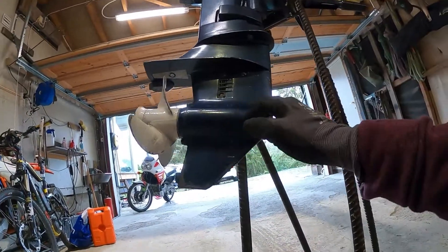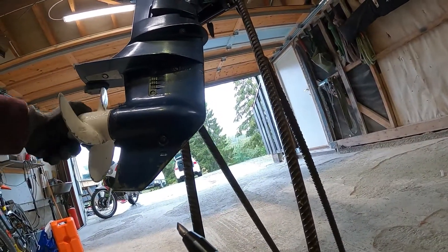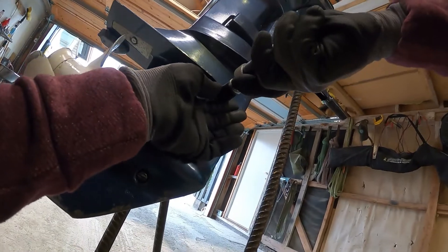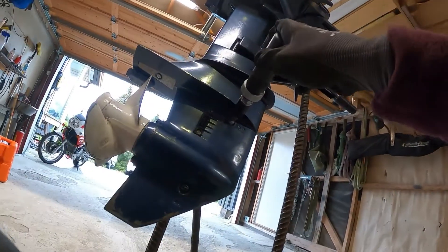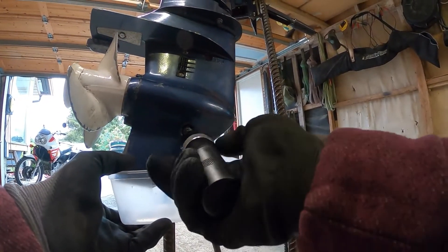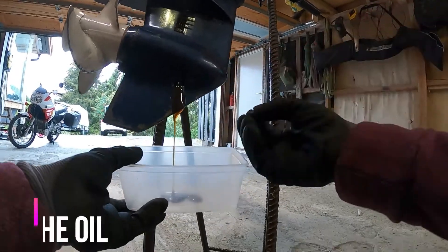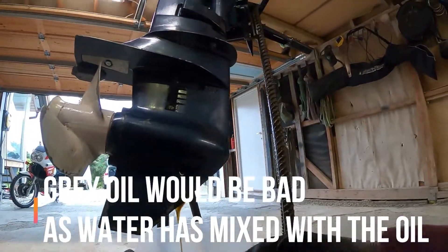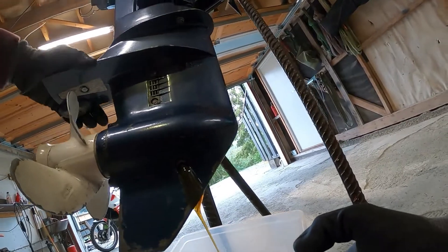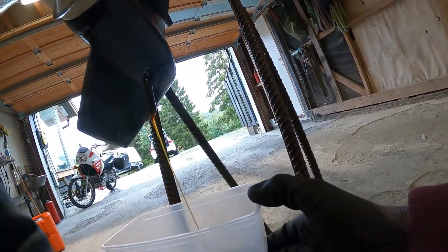The first thing I like to do when I survey is to check out the oil in here, just to see how far gone it is. Loosen the inlet to get some air in, have a little cup ready and see what comes out. Okay, it doesn't look so bad. It's this brownish color — it could be a whole lot worse. I'm happy with that. I'm gonna change it, put some new back in.